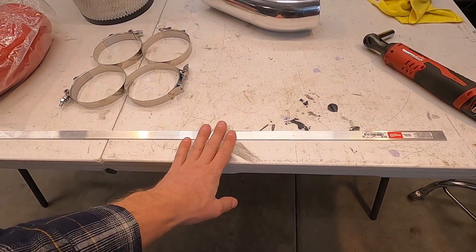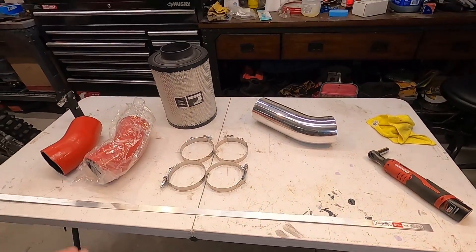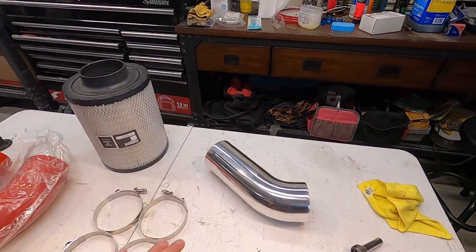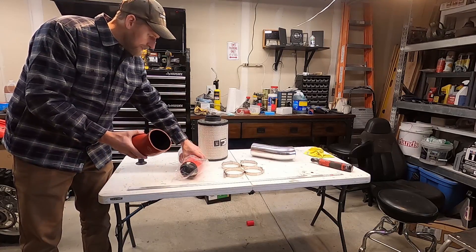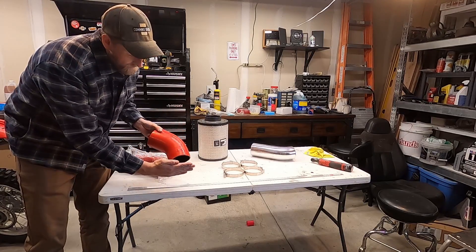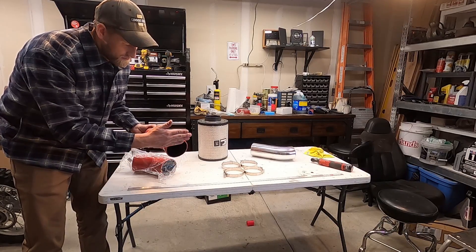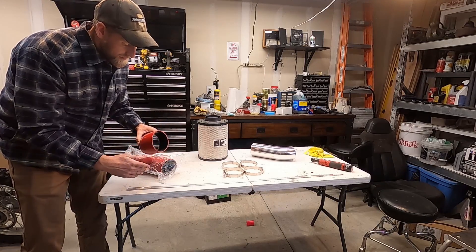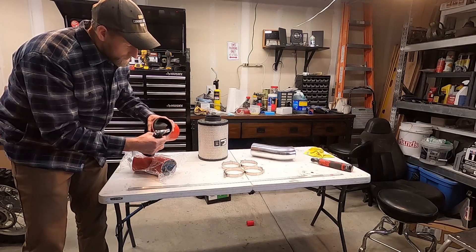Now let's go throw it in the truck. I'll show you one piece I bought yesterday that I haven't fabricated yet — I'll explain what it's for near the end of the video. I think we'll first assemble everything here on the table and then put it on the truck. I bought two of these elbows. When I fitted this onto my truck yesterday, this end had about an inch and a half extra and it was hitting the alternator, so I cut about an inch and a half off with a knife and used a torch to singe the fiber edges inside.